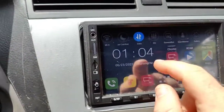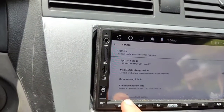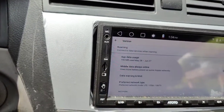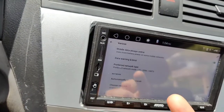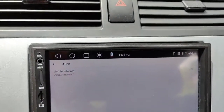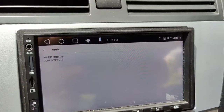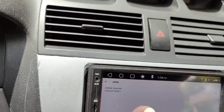When I went into the settings, I was able to find that the APN — the access point names — you're supposed to be able to fill that out. If it doesn't have the right one, you should be able to put one in. I have an access point in there right now. I had to add that manually. It wasn't there by default, and I wasn't able to add one either.